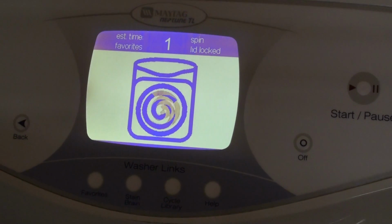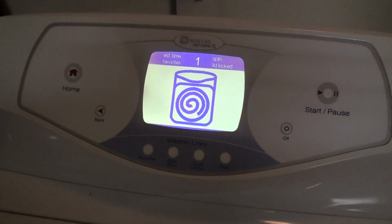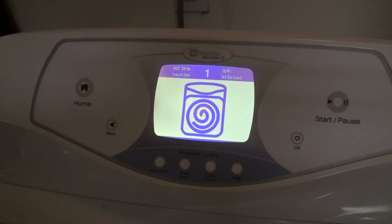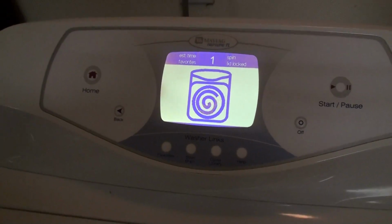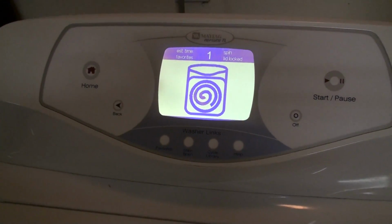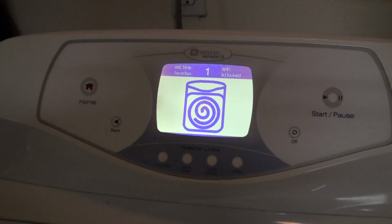So as you can see, when the washing machine is in its spin, the clutch is basically freewheeling off that bearing, which is just like the bottom bracket of a bicycle. And if it's not well lubricated, if it's not spinning freely, it's going to catch, and it's going to throw the tub off balance.